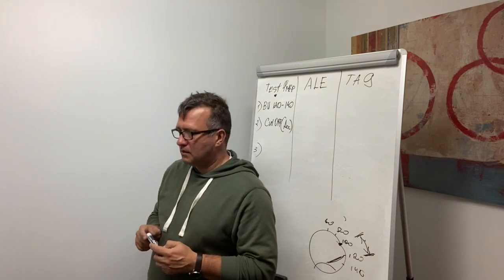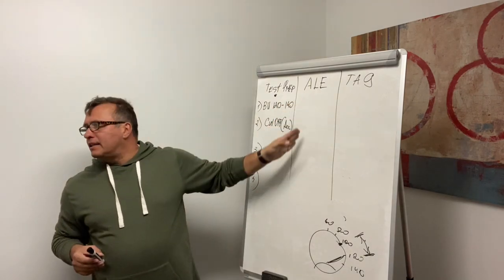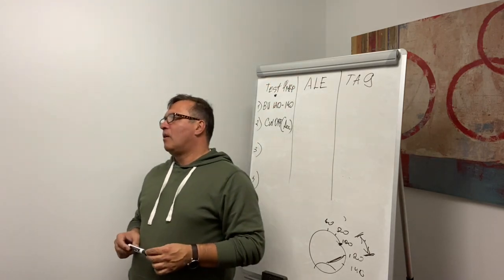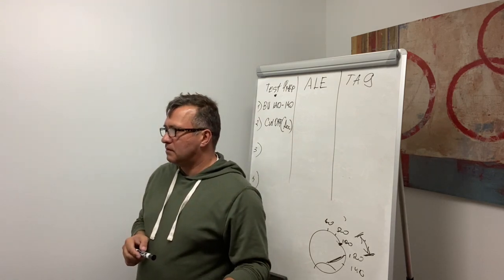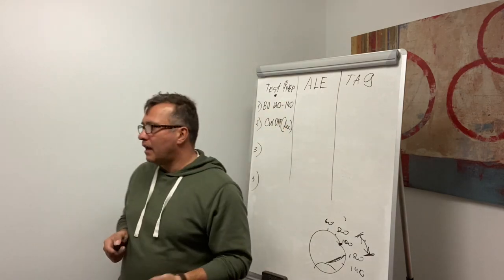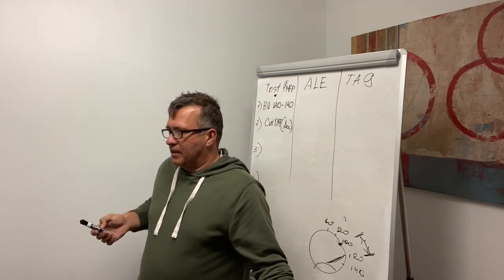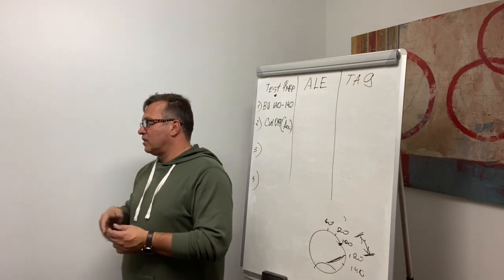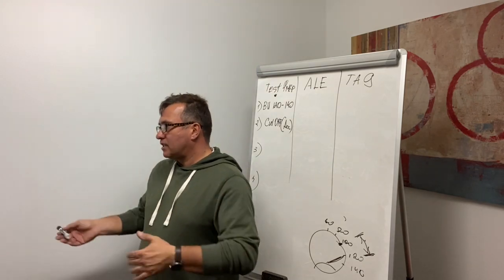Safe. At this point, at the air leakage test, you're going to figure out how much air your system is losing when you're pushing the brake pedal. This is the first part of the test. How much is it going to lose if your compressor is constantly supplying air? Okay, you got it, right? So you need to turn off the engine, so stop your compressor from building up the air. That's how you can see how much you lose.